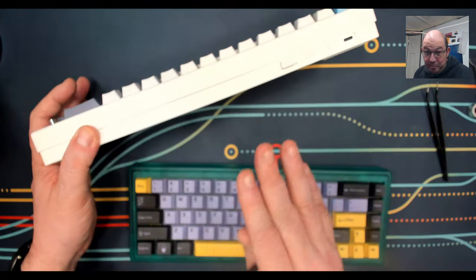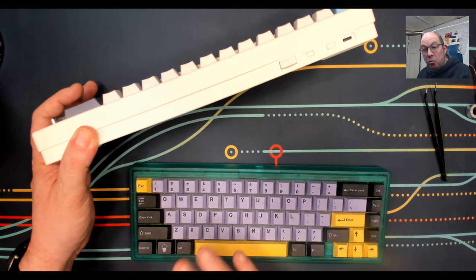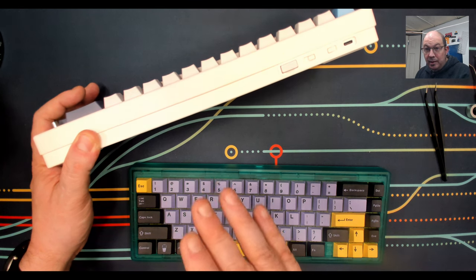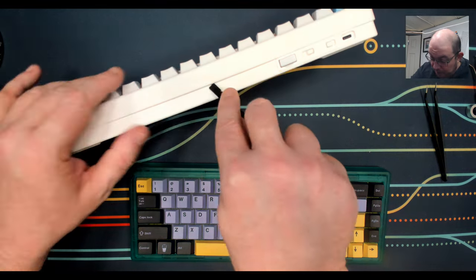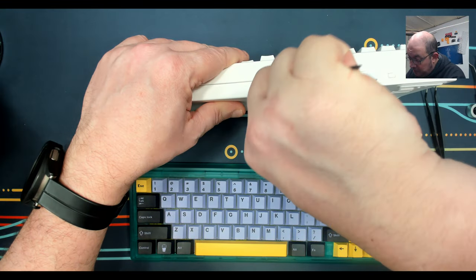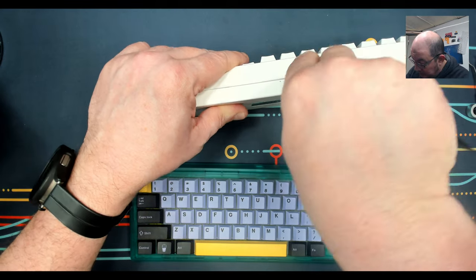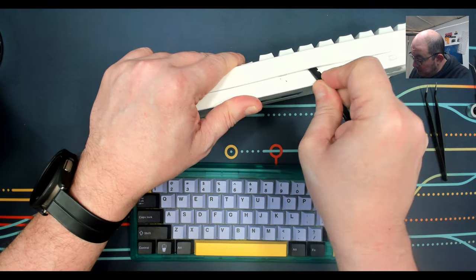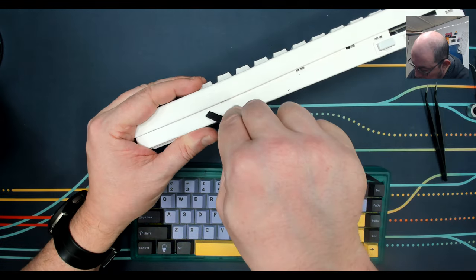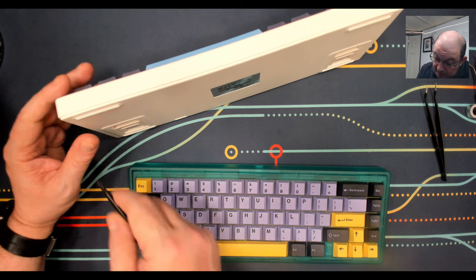Like I said, that finger video, I would not personally try it, and I would not pull the top off before unlatching both the top and the bottom. So you can go straight down into it and then just curve your tool up. Obviously you want a flat spudger tool, and then you just start going along the edges. It starts popping off.